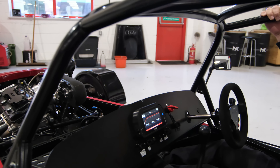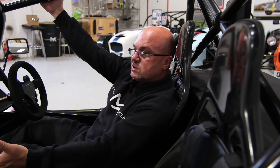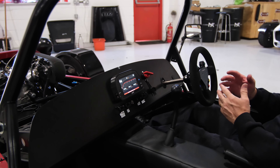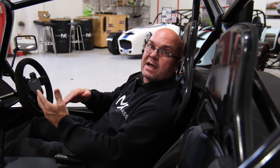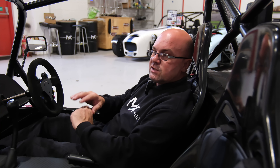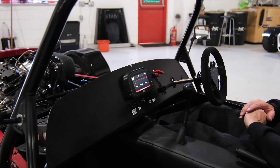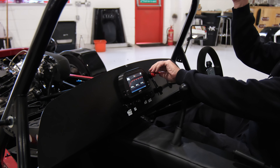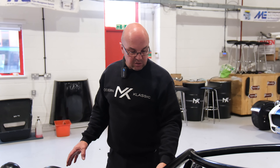On these you can do cowl switches - which is done on this one. You can put in wiring for calibration switches and run switches, and program it to have a fast idle when you're warming up. It actually has that on this car - it picks up the idle so it warms up quicker, and once it reaches a certain temperature it comes back down. It may run at around two-thousand-plus RPM to warm it up quicker. We always warm up the race cars before going out on track anyway to make sure the oil is above 40 degrees. There we go - starts and runs really nicely.